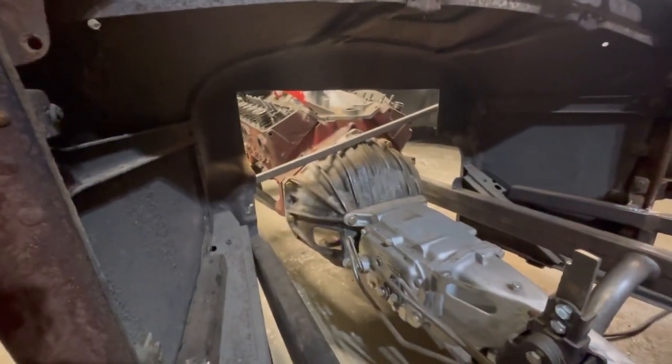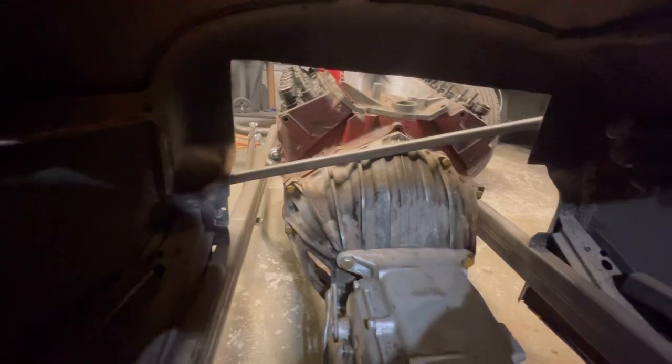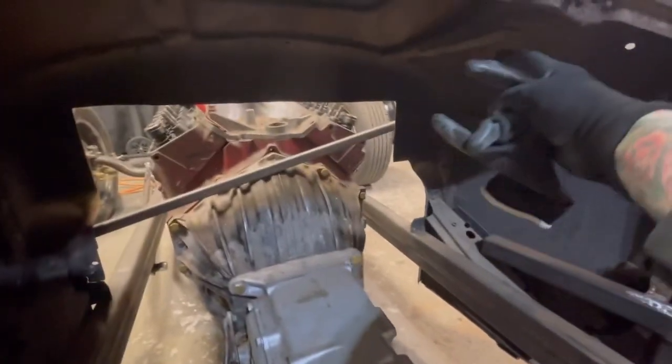But also, they have the 90-degree power masters, which are power assisted, right? Brake boosters. They have a 90-degree one that essentially would go up in here. The pedal would come down, you push it, it swivels and then pushes a 90, and there's a brake master and a booster and a brake master. It's like 20 inches wide, so it'll roughly put the brake master cylinder over here.